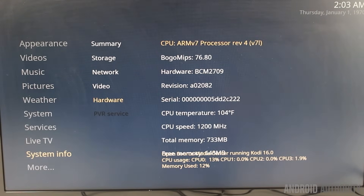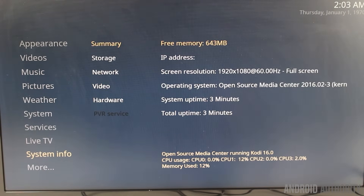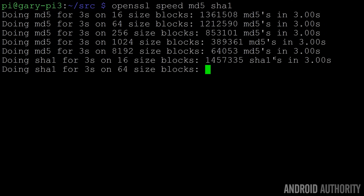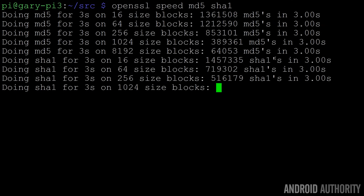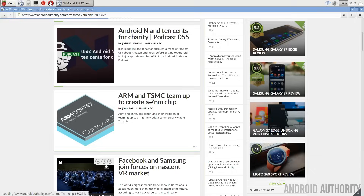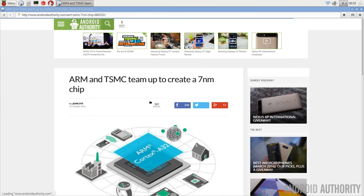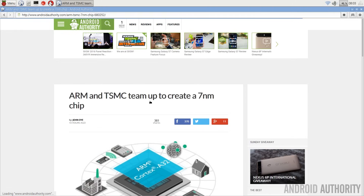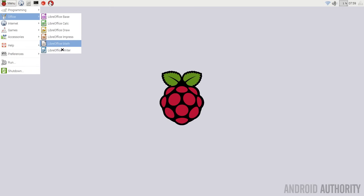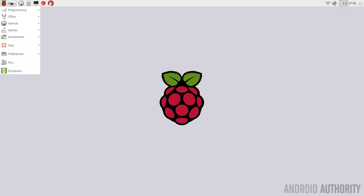When it comes to performance, the Raspberry Pi 3 is faster than the Raspberry Pi 2, in no small part because the new CPU is clocked at 1.2GHz compared to 900MHz on the Raspberry Pi 2. I did some testing using the OpenSSL speed benchmark and my figures show the Raspberry Pi 3 is around 35 to 40 percent faster than the Raspberry Pi 2. As for real-world desktop performance, the Pi 3 has certainly nudged the Pi a step closer to becoming a true desktop alternative — loading a web page like AndroidAuthority.com is about 50 percent slower than a modern desktop, and launching a program like LibreOffice Writer is around three times slower. However, the idea of the Raspberry Pi 3 isn't to replace the desktop — it is a tool for hobbyists and educators, and as such the performance is excellent.